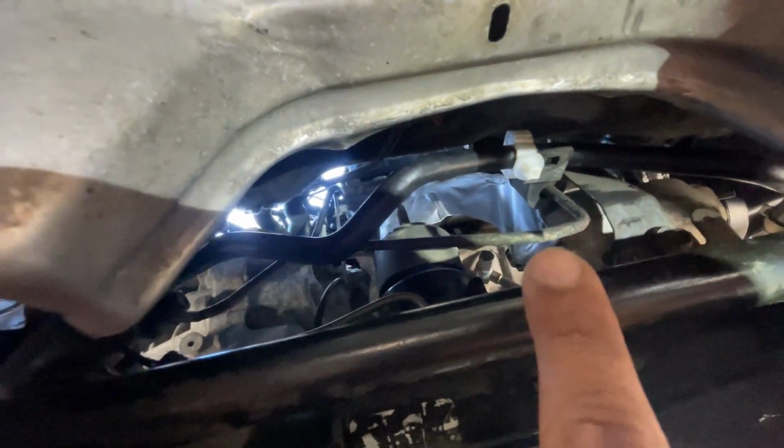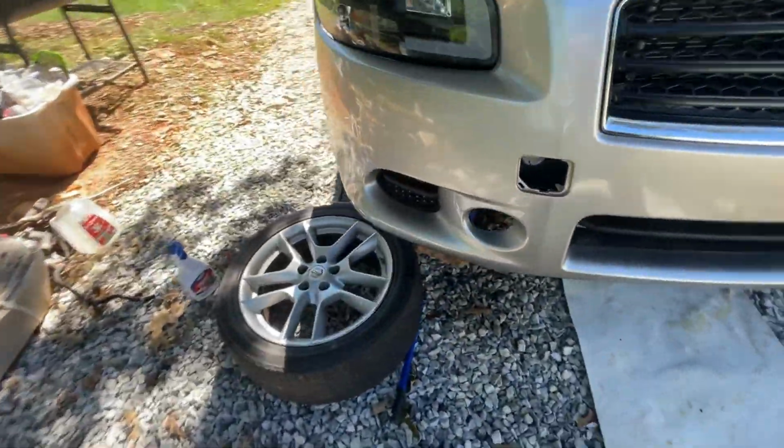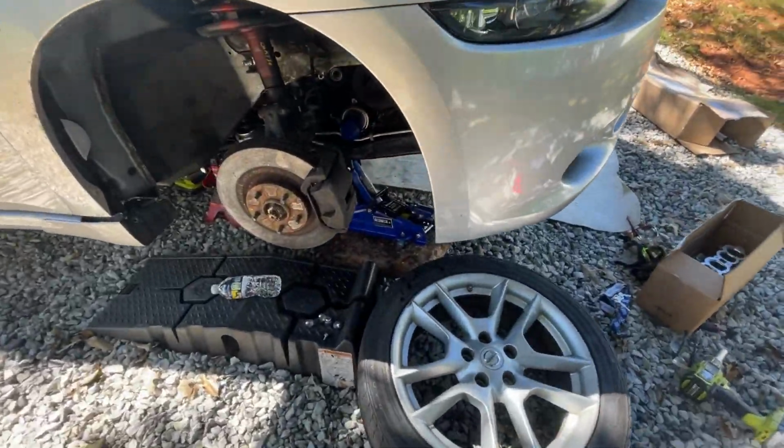And then this side, I'm not going to put the hose clamp in because this rack and pinion is getting replaced in the upcoming video as well. So I'm not going to put the clamp in there. I had to struggle taking it back off. I'm going to be one and done. So for right now, I'm just going to wiggle it on as so. And then, like I said, next video is this high pressure hose line getting replaced. So that's how you replace the lower rear power steering line on the 7th gen Nissan Maxima.